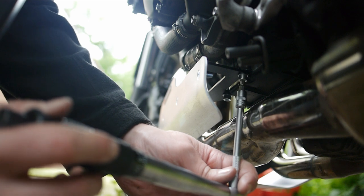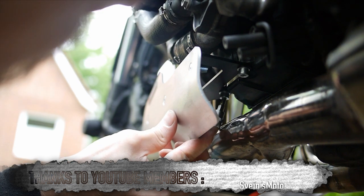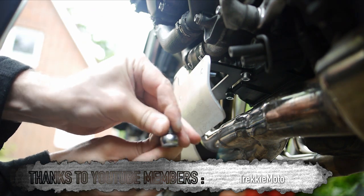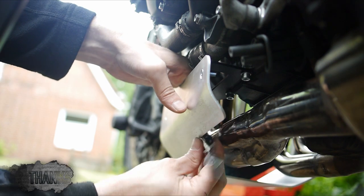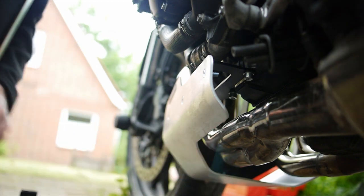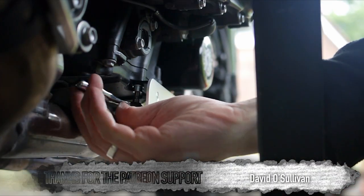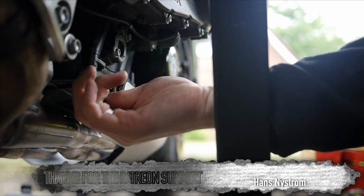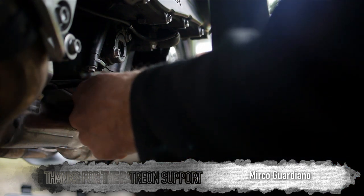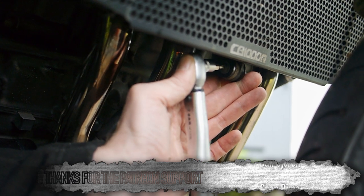That's not easy, so get an extension in there before I scratch everything to pieces. This does make it a little bit awkward that you can't tighten that before you've screwed everything else on. So for that one I'm going to have to go for the guesstimation torque wrench and use a tool that can actually get in there. That feels about tight enough. Round to the other side - obviously the torque wrench doesn't fit into that gap, so a variation on the guesstimation torque wrench there too. Hard to believe that's tight enough after how much effort it took to get it off. And then keyhole surgery for the last one. Round over the front for the final bolt - also ten newton meters of torque. There we go, and that's the job done.